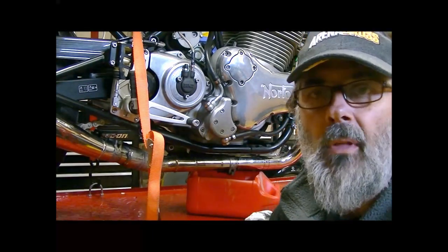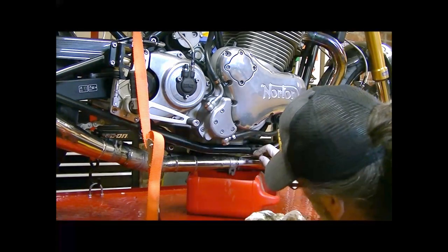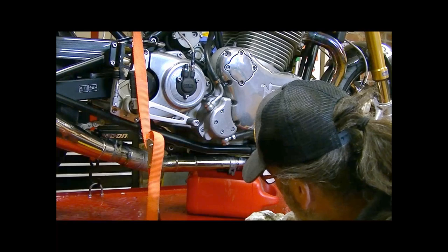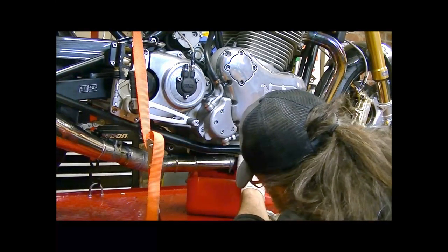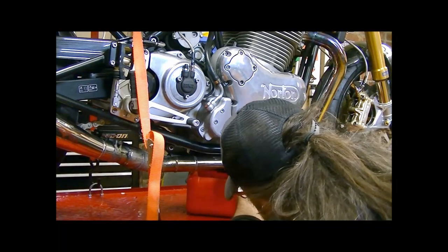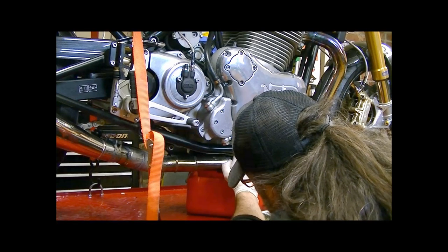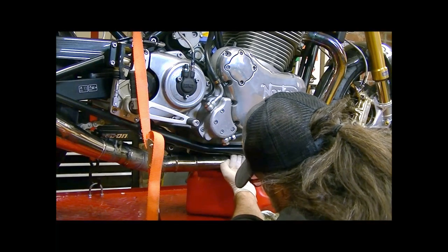I've taken that out so I'll just put that to one side. The oil drain plug is underneath here - it's just underneath there. It's very awkward to get to because of the exhaust pipe and in actual fact I can't get a socket in there, so I have to undo it with a spanner. It's got quite a long thread on it so it takes quite a few turns to get it out, but nice and gently does it.